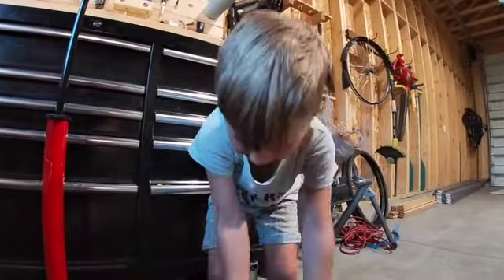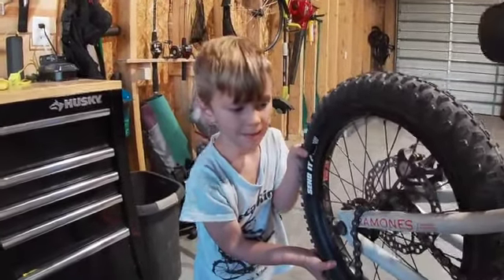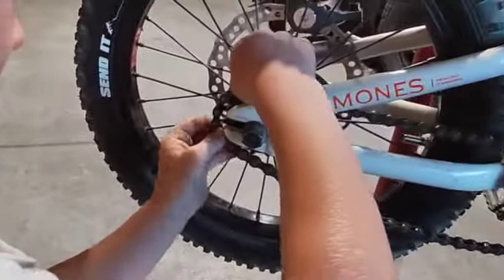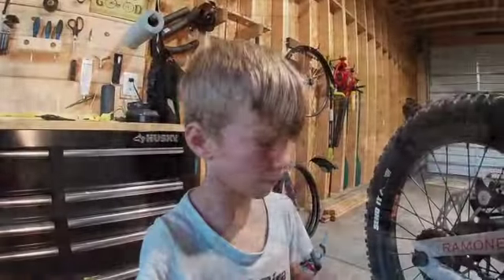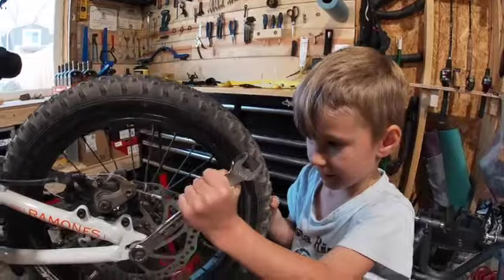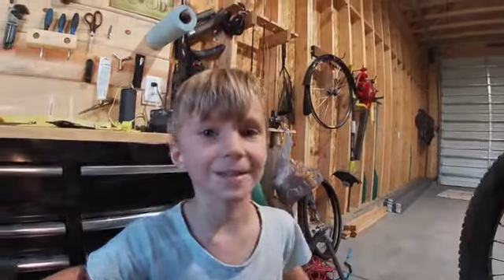Let's install this on the bike. Let's slide it into the dropouts. Now let's put the chain on. Now let's tension the chain — let's pull the wheel back and tighten the nut. One last nut. Time for one last touch.